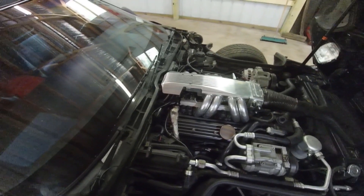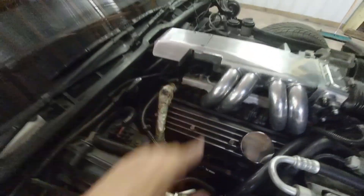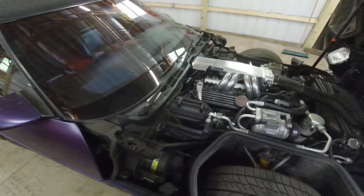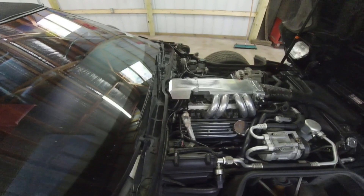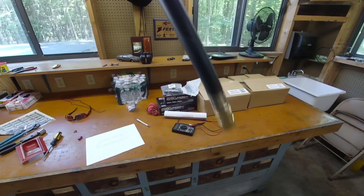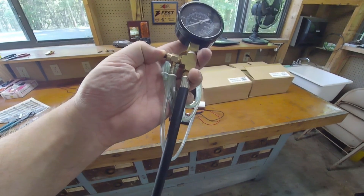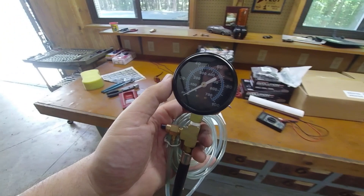While we're here, we're also going to test the fuel pump. The Schrader valve for the fuel line is right here — it's just like a tire stem. You roll the cap off and then connect the fuel pressure gauge to it, put the car in accessory, and you should hear the fuel pump prime. We'll be able to take a reading on the pressure in the rail. I should have 43.5 pounds of pressure in there — it should maintain that pressure and we shouldn't see it drop. This is my fuel pressure gauge — it has the connector that screws onto the Schrader valve. When I prime it, we should see the needle go up to about 43.5 pounds. The clear tube is for releasing the fuel when you're done — put a catch can at the end, push the release valve, and it'll dump the fuel down the clear line. Make sure you've got a gasoline-safe container to catch all that.